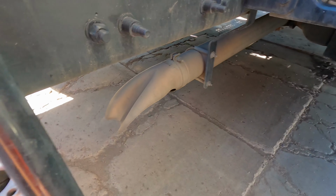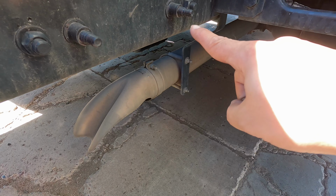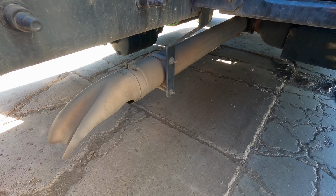Now, when it comes to the right side of the trailer, all you need to say is that you will check the right side of the trailer the same way as the left side of the trailer, with the exception of the exhaust system. Connected tightly, mounted securely, and no loose clamps. You can check signs for any leaks and should not have any black soot.